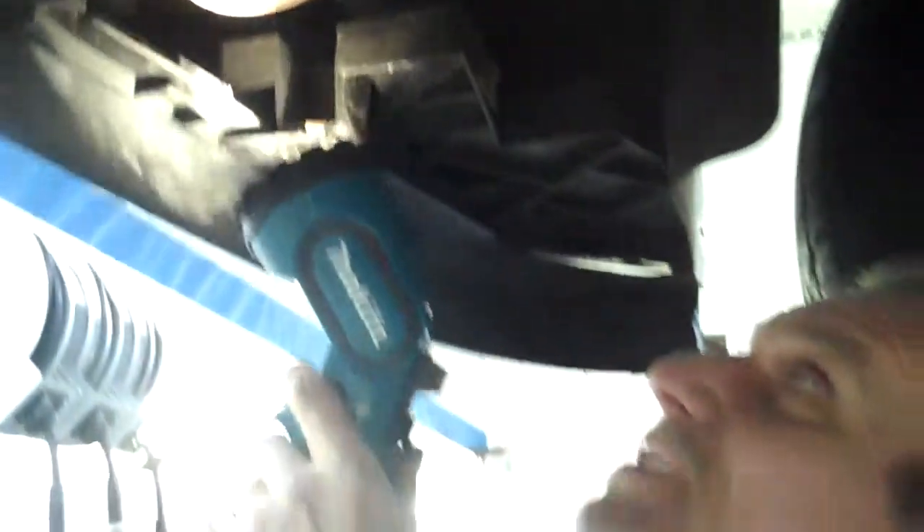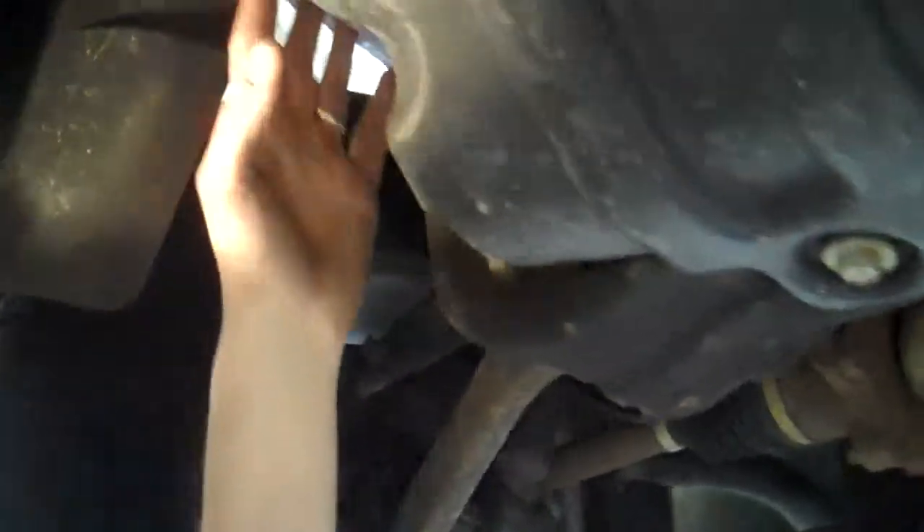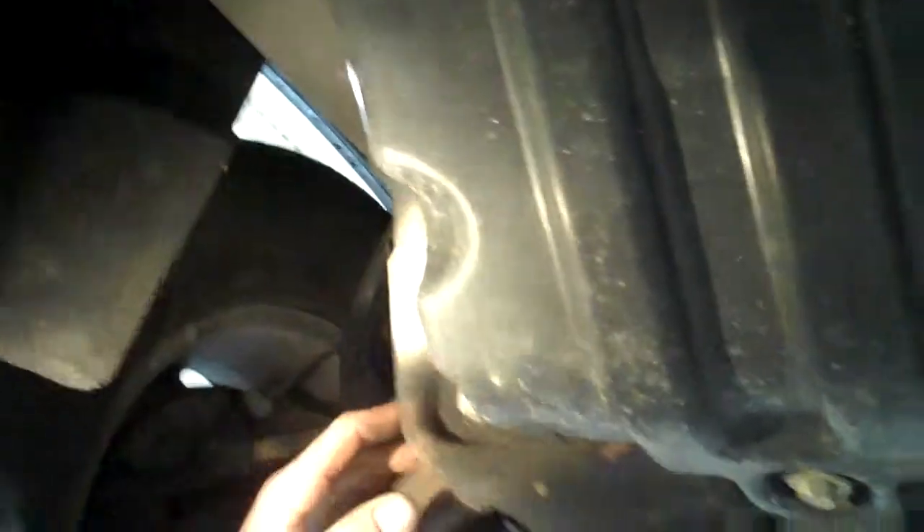There's a little bit of — I don't know exactly what went on here — but on the very bottom edge of this front frame rail, the frame rail is a little bit tweaked down, but it's just the bottom edge of it, not the whole thing. It's hard to see on the other side, but it doesn't look like there was anything much more than superficial damage. You follow the frame rail back and it doesn't look like it's ever been bent that severely.